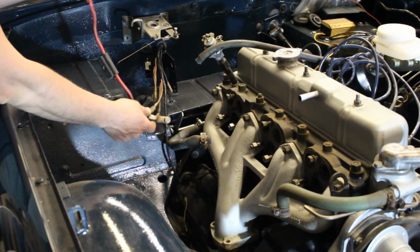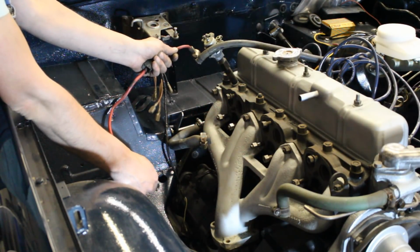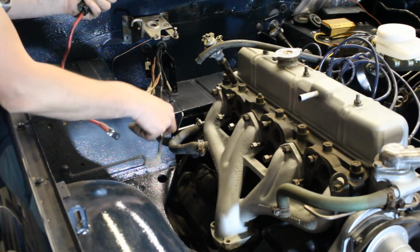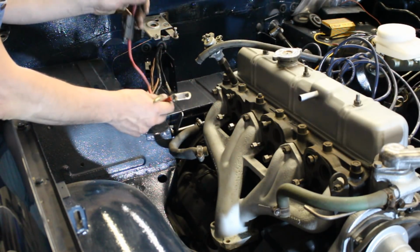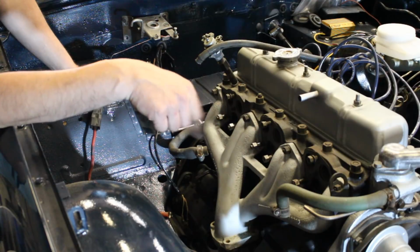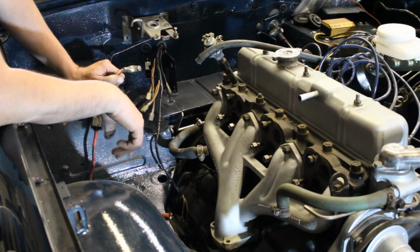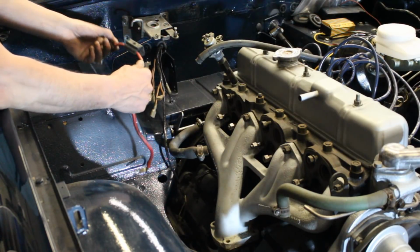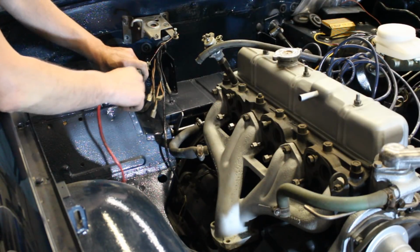And here is what it looks like in reality. This is the main battery cable from the positive terminal on the battery to the starter down there, and these are all the brown wires that we're talking about, and the white with yellow and white with red. So I just cleaned this one, and what I didn't do on the headlights, somebody reminded me, and I'm gonna start doing that now everywhere, and even on the headlights I'm gonna redo it. I'm gonna start putting dielectric grease on all terminals. So I'm just gonna put this little hub, so that's the hub, obviously. I'm gonna put the electrical grease here inside.